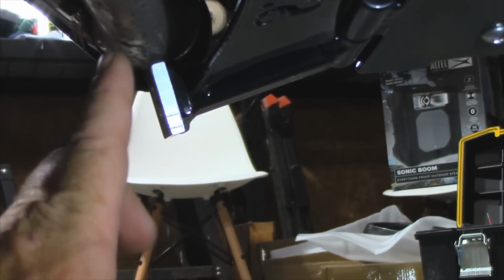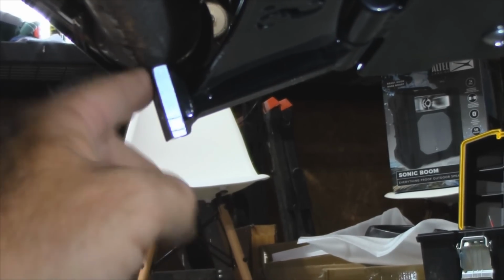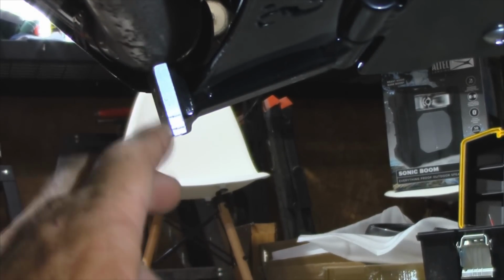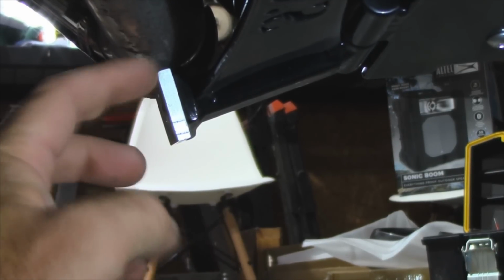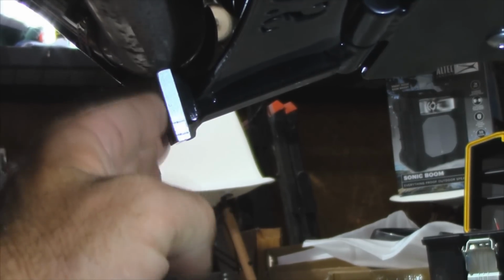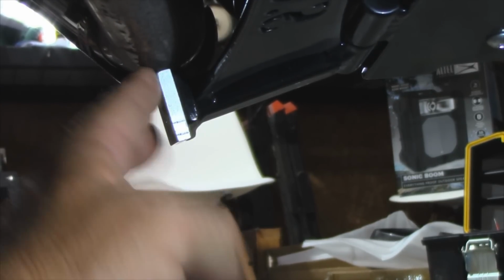And basically what I'm going to do now, my last option, is to heat this pipe right here and crease that up just a little bit. The dude over at the exhaust shop said that they do it all the time. They just heat this up and crease it, so this will go up another, probably quarter to half inch, depending on how much I crease it. As of right now, that's as high as I can get the center stand.